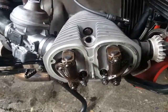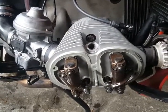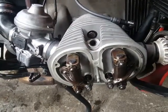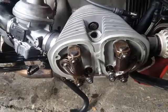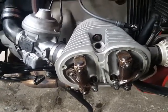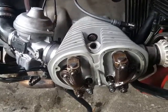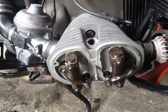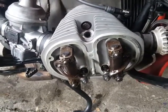Like when you put an engine back together, generally speaking, you have to break it in a little. Everything's not brand new, but I just took it easy. I didn't rev it hard, and I didn't let it labour, and I just varied it up and down the rev range for a while just to give everything a chance to get settled. Same again this morning. Gave it a couple of bursts just to see how it was all going to pull, and gradually now over the next 1,000 k's or so I'll just give it a bit more and a bit more. Not that I ever ride bikes particularly hard, but I'll start getting back to the way I generally ride my bikes over the next week or two.